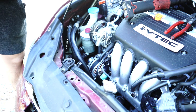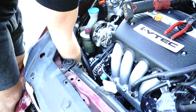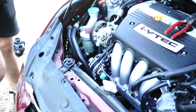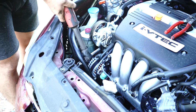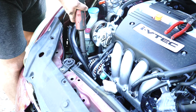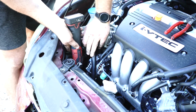Point, guys, you can now move to putting your 2 bottom bolts in, just doing one at a time. Once you get one, the other one will happen easy. Okay, so once you've done those 2 bottom ones, we're going to first tighten the top one to where it's not completely tight, but it's quite in.